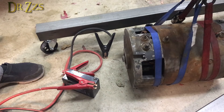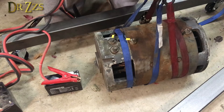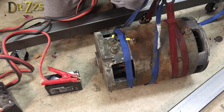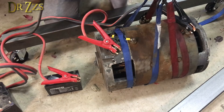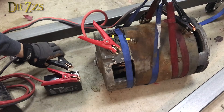I'm going to test this not the way smart people do it. Before I destroy the transmission to make it fit on this motor, I want to make sure the motor is going to work. This is a 12-volt battery. This is a series-wound motor, so we've got a field and armature with a plus and minus on each. I'm going to connect those two together, then connect positive on one and negative on the other. If it spins the wrong way, I turn it around. If it spins the right way, I leave it. If it doesn't spin at all, I guess I go get another one. This is a very real 'it'll work or it'll explode' moment.